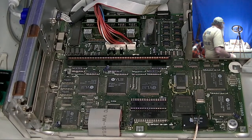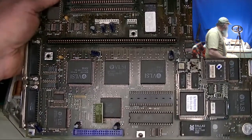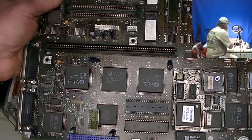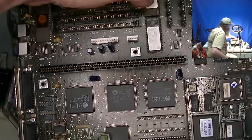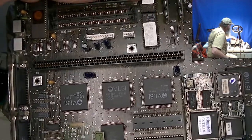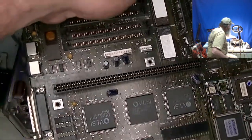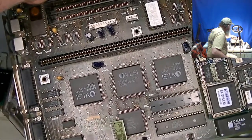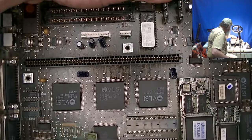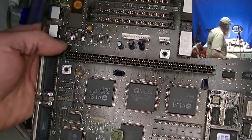Now I have a Type 2 planer as well. You can ignore the Kingston upgrade CPU module that's on there, but the Type 2 is notable for having two different EEPROM sockets — an odd and an even — and having these boards for the video memory that are soldered in. But otherwise most all of the chip component locations are the same; it's the same general layout with SIMMs and power connections.